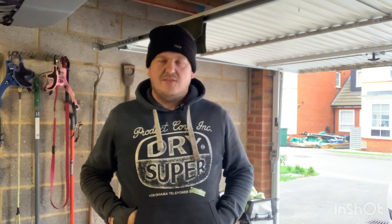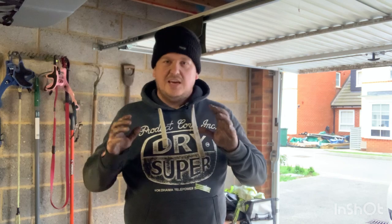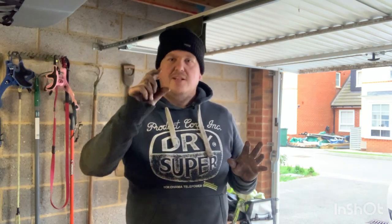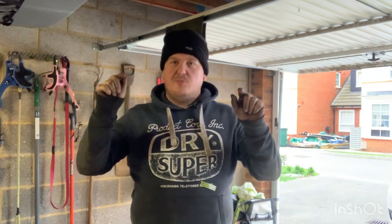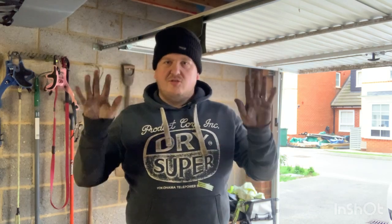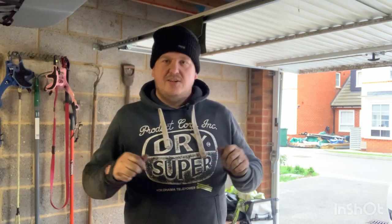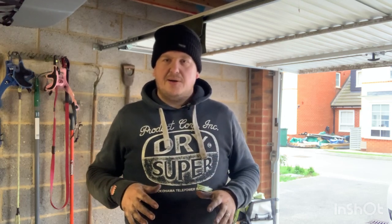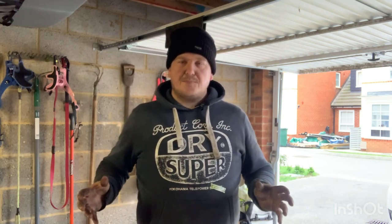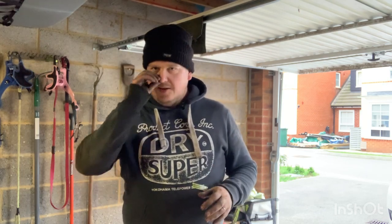Right, so that's the end of this video for today. I've taken everything off I can take off until the engine immobilizer kit arrives. Then I'm going to be taking the starter motor off, immobilizing the flywheel, and putting the 2 pins in the 2 pulleys in the top of the timing chain to make sure that the engine does not move when I slacken the timing chain off. We'll then get the oil pump out, change the oil pump. The water pump came out today. Once all of the new parts are back in, we'll rebuild. That'll be all in one video.